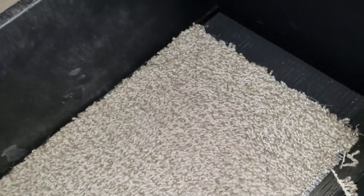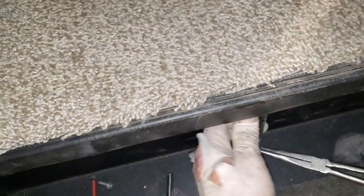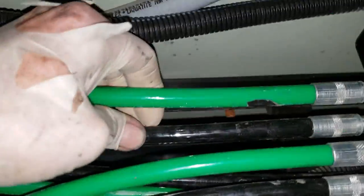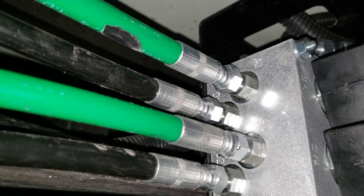I'm utilizing the same hole right there. I ran it to the house batteries - there's the breaker that goes to the pump. Underneath the dinette right here is where I've mounted the brains, the level sensor. Outside I'll be able to pull in a lot of the extra harness and zip tie everything up. I got it all wired up under here. For the hoses, green was extend and black was retract - because on these ports you have A for extend and B for retract, and B and black makes sense in my mind.